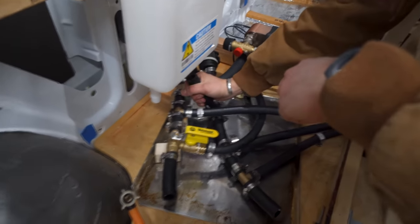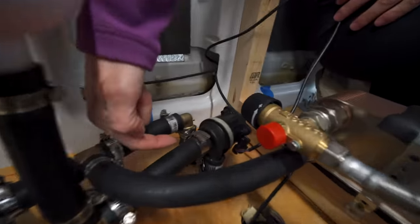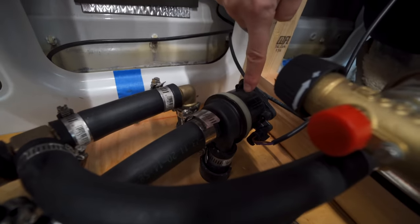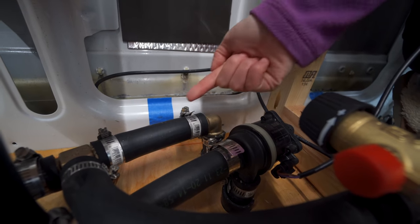That fitting is fitting. And I guess I'll also point out that the pump in your system is directional. So make sure that you have your header tank, which then leads into your pump, which the fluid will be pulled in and then pushed down through the side, which should go straight into your heater. And then that'll heat it up and send it through your system.